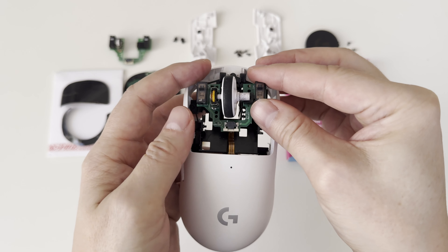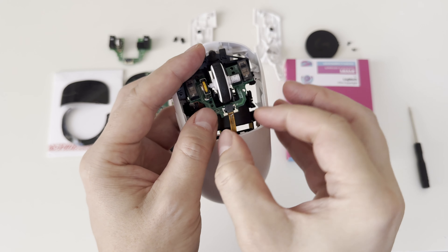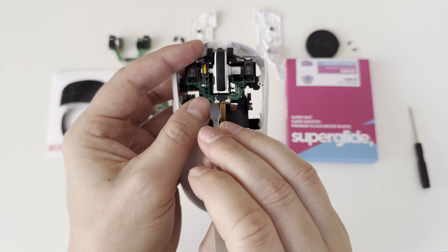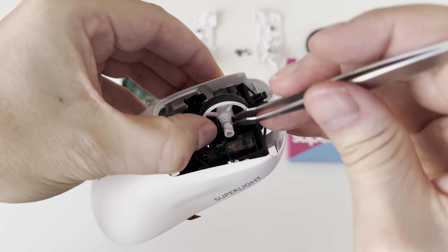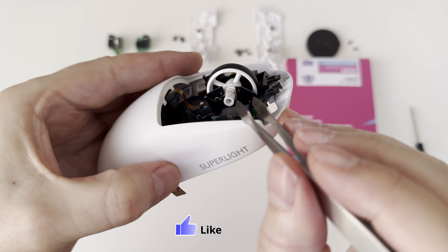Now I can place the upgraded switches board back into the top cover of the Logitech G Pro X Superlight gaming mouse and insert the ultra-thin ribbon cable into the opened connector on the switches board. This cable is the only connection between the switches board and main board, so make sure it fits properly. Then I use the tweezers to lock the cable into the connector to ensure it will not fall out. Replacing and installing the tension spring properly above the right side of the scroll wheel is one of the most difficult parts of this reassembly, as the spring can jump out and you can lose it forever. After a few tries I finally managed to install it, and this is how it should look when the tension spring properly holds the right side of the scroll wheel. Only a test of scrolling can confirm it is properly installed.